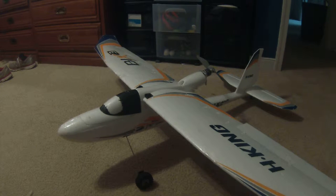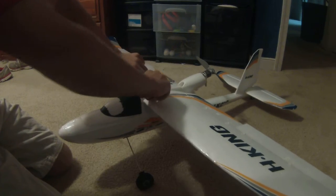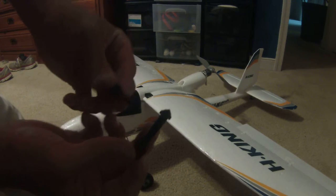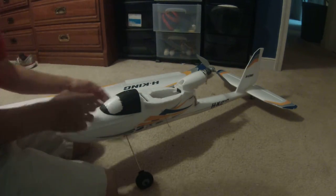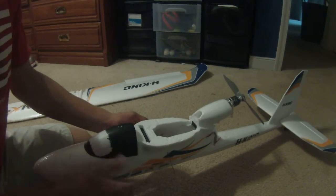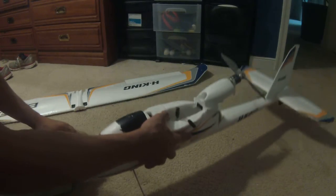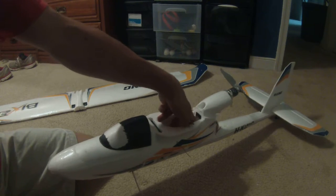If you do that upgrade, you also have to upgrade the ESC. To get the wings off, it's just these two little clips — you turn and pull out. I'd recommend buying an extra pair in case you lose them, otherwise you can't fly. On the inside, there's my ESC from a friend, my receiver, and I'm running an orange receiver with an orange satellite down in the tail. A Spektrum satellite also works with it, so you can save yourself $20 if you have a Spektrum or other compatible satellite.